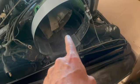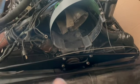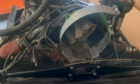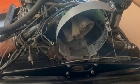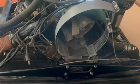The alternator, which on this model is actually a generator, is being sent out for rebuild. Some of the factory pieces, for example, Porsche did a lot of epoxy on the solder points, and we wanted to look at the condition of the wires and things like that. So we just went ahead and rebuilt the whole thing. We are going to try a different stator that is supposed to bump us up to 90 amps instead of the 55 amps they came with.